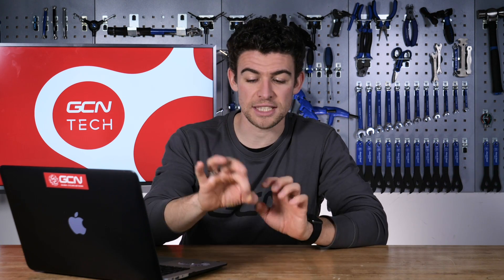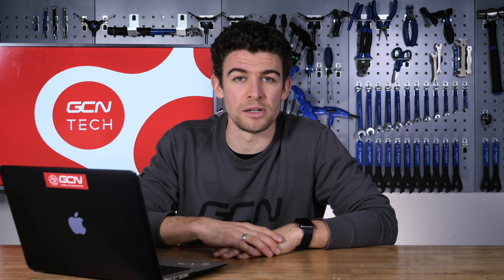Well yes, you absolutely can Steve, and in fact it won't be that difficult to do. The major issue you're going to be faced with is sealing over those frame holes where the tiny wires go in where the big cables used to be. But there are bungs available on the internet, and if you can't find them I'm sure you can fashion something yourself. Once you've done that, you're going to have a really neat looking build as wires look so much better than cables. I think you'll breathe a whole new lease of life into your Scott. Mechanical shifting is great, but I really do like DI2, and I'm sure you will as well. Enjoy.